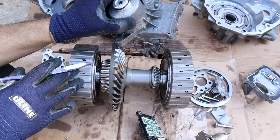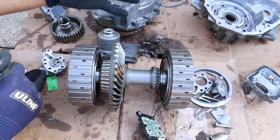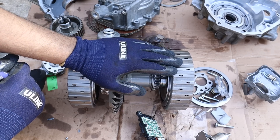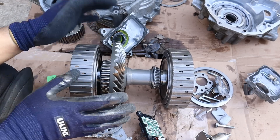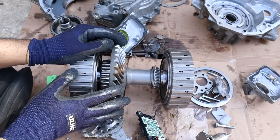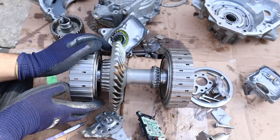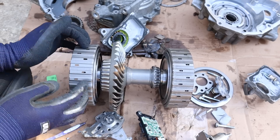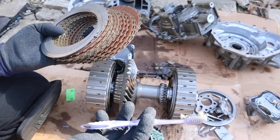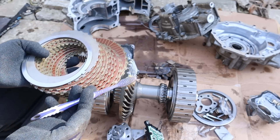Having an electric motor on the rear differential is actually pretty common on front-wheel drive based all-wheel drive vehicles — it has a clutch set in front which decouples the pinion from an open differential at the back. It's a pretty good setup to have in the back for a little bit more driving dynamics, because it would be pretty expensive for Honda to develop a longitudinally mounted rear-wheel drive vehicle, which they don't have. At least this provides a pretty good solution for those looking for better dynamics. And that's a look inside of Honda's super handling all-wheel drive system and how it works. Make sure you subscribe if you want to see more videos just like this one.